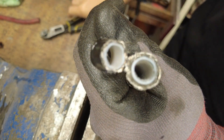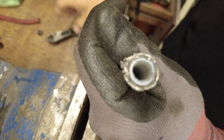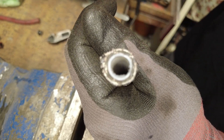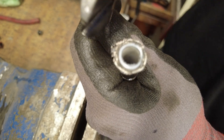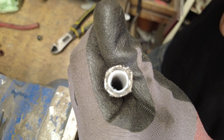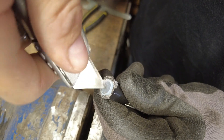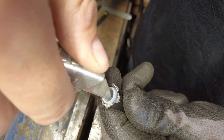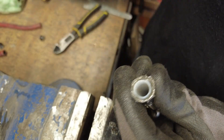The cut gives us a result like that. It's not fully cut through at the end, so use snips or decent scissors to take that off. You can see it starting to flare out a little - with cheaper tapes it flares out more because of the heat. You need to trim off any excess. There's a little bit of flash on the inside of the Teflon, so just get a knife and gently scrape it off - it comes off very easily. It's not critical because the part that clamps down isn't this very first section, but it does help get the fitting on easier.